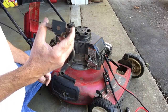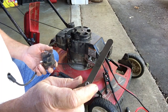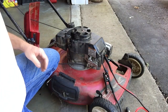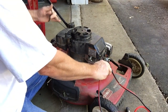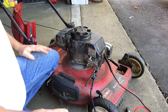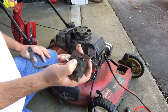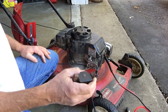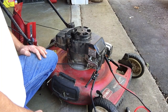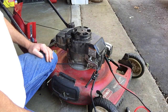I swapped the electrical piece out. I didn't find the measurements online, so I used a feeler gauge — .022 inches, or 22 thousandths of an inch — measuring from the center piece to where the flywheel was. I hooked everything up and I have spark. I went ahead and hooked it up quick and it did start right up. My issue might not have been the coil itself but rather the distance, since I had more than 22 thousandths of an inch before. I'll keep the old coil, write a note on it as 'questionable,' and put it in my spare parts box. For now I'm going to button this thing back up and use it to mulch some leaves and bag them for the farm.